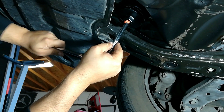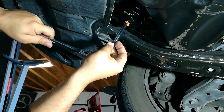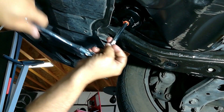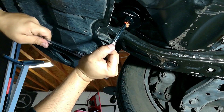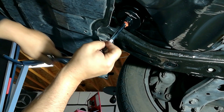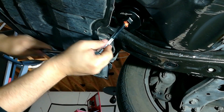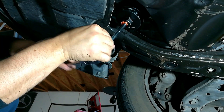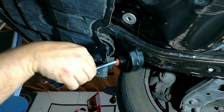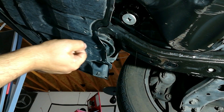I'm going to go ahead and remove the oil filter out of the housing now, with my pan underneath. I'm slowly backing it off — I'm not using any power tools, because you're going to get yourself in some trouble by doing that. It slowly comes off, and there's hot oil in there so I want to be very careful. If you have the time, you want to go ahead and let this slowly drain out. I let that drip out slowly, so now it's ready to be removed.